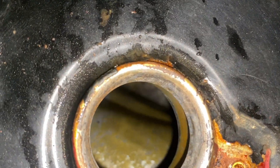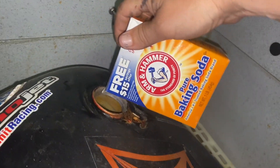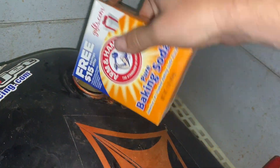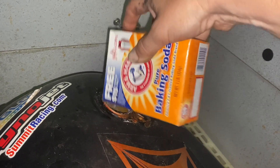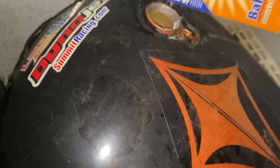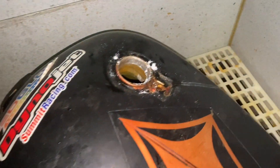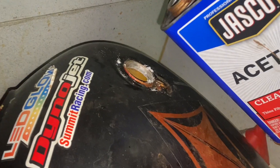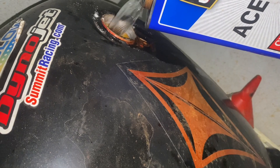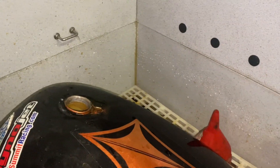Since I don't want to use water, I'm going to try acetone. We're already getting flash rust — that's what happens right away. So let's get some baking soda in there to stop the acid from doing what it was doing. Shake it around, start to fizz, do its thing, and then I'm just gonna use acetone and try to avoid putting water in here. I feel like that's a good way to go — I've heard paint thinner also works.